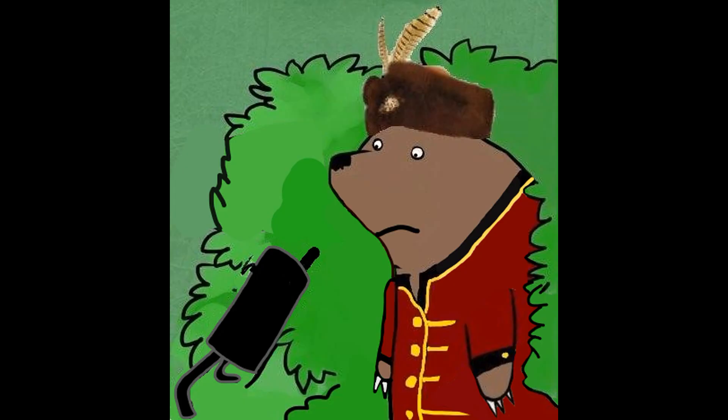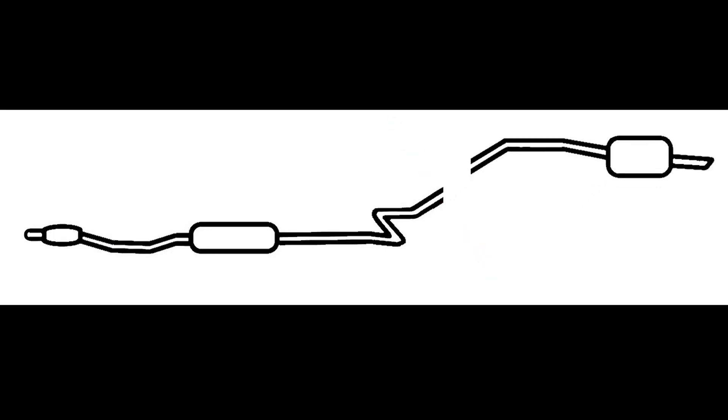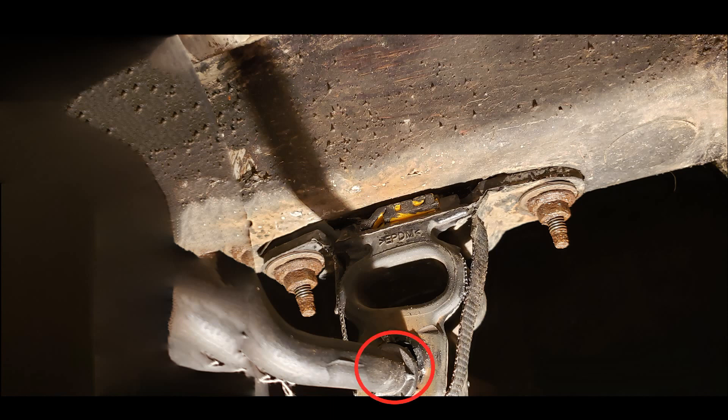The arch was in a good condition and nothing needed to be done, which I cannot say about the silencer. After seven years, the outer layer vanished due to corrosion and started making strange annoying noises. The only trouble I encountered was that there was no silencer for my 1.6 engine model — only 1.2 versions were in stores.